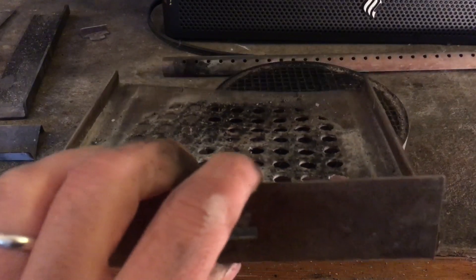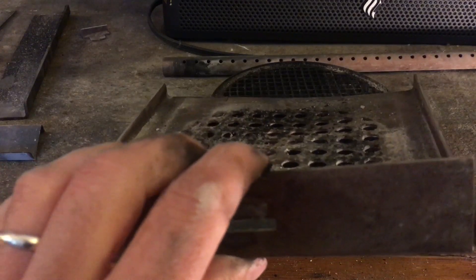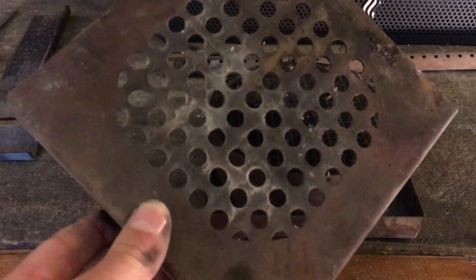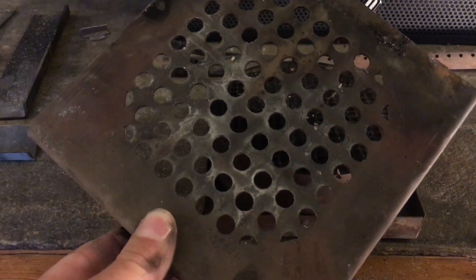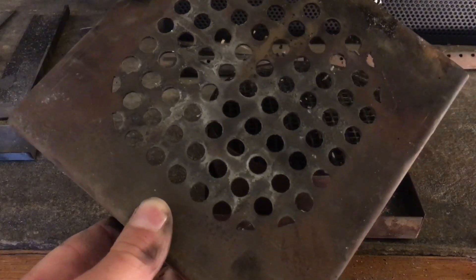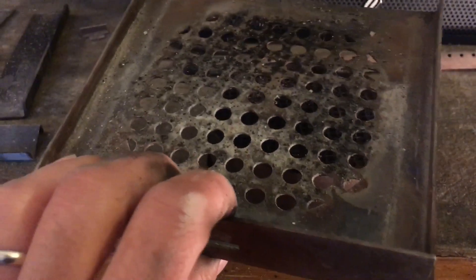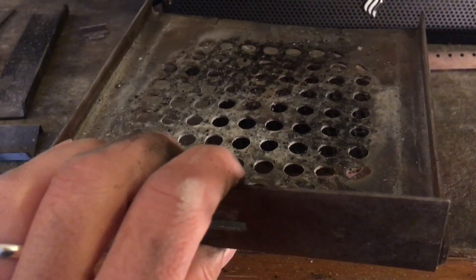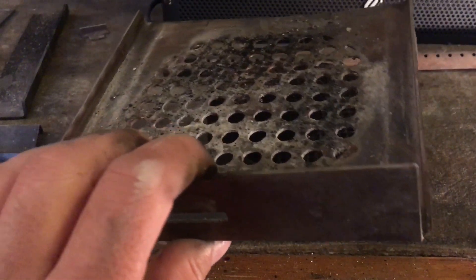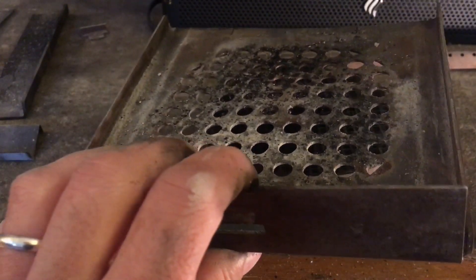This is why it's a little bit difficult to get this out — you can see the mild warping that's happened. This piece just takes a ton of heat being right by the flue exit and around that combustor, where temperatures are going to routinely be up a thousand plus degrees. That just tends to warp some of this thinner steel due to heating and cooling cycling, even if it is stainless.